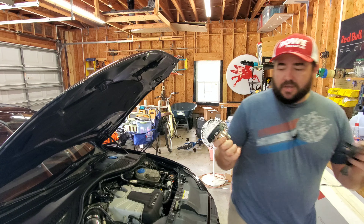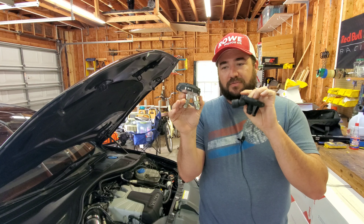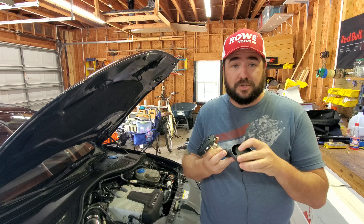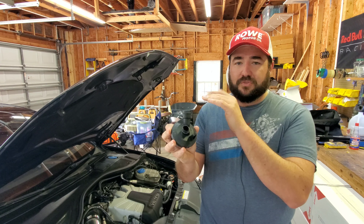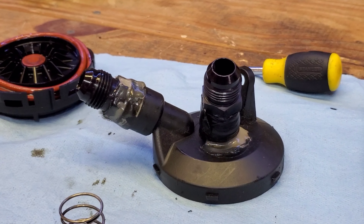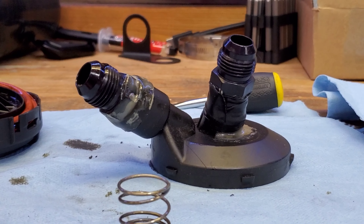What this is, is a piece that replaces the bottom half of the relocated PCV — this is the pancake PCV. If you watched our DIY, also linked in the description, you'll remember that on the bottom, these pieces here, we have to modify them. We have to hollow them out with a Dremel, put fittings in there, and JB weld them so that they stay in there. It's a mess and kind of a pain to do. Not everybody's comfortable doing that.